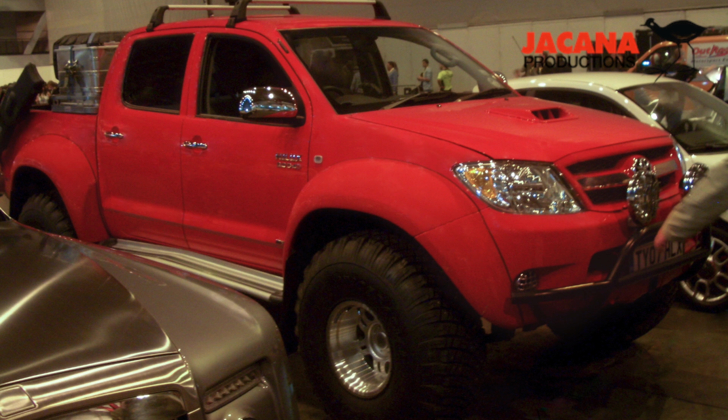But anyway, thanks for listening, watching this video, and hopefully you've learned something. And the next time you get stuck in the snow or ice, make sure you have a tire pressure gauge and you have a way to inflate your tires afterwards, or just try deflating them to 5 or 6 psi. I mean, you could go to 20 psi probably and still make it home okay. You can't obviously drive too fast at 20 psi, but anyway, there you have it.